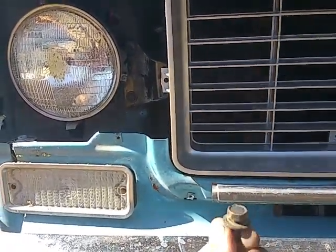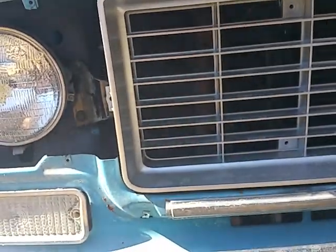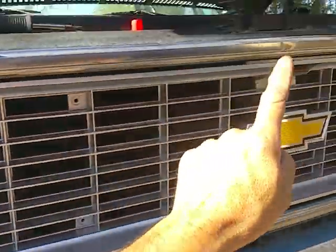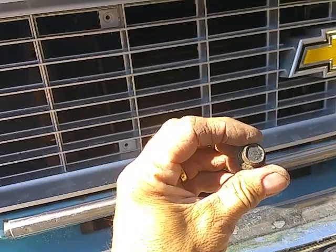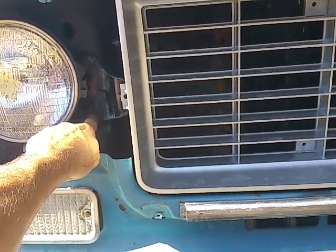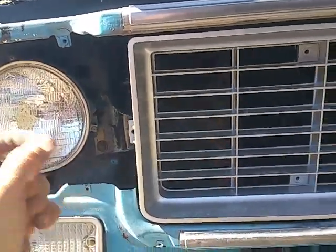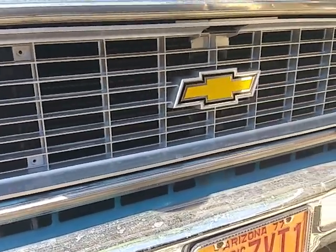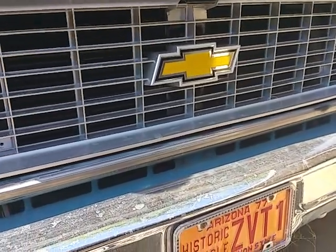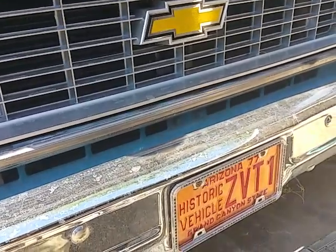These screws will basically be supplied with your truck, so they'll mount those brackets for you. Order the brackets, center support, and grille. Get yourself a small drill bit — maybe three-sixteenths will probably do it — and a screwdriver to take out the headlight bezel. That's really all you need. Thanks for watching, guys — have a great day! And if you like what you see, please subscribe to my channel. Thanks!